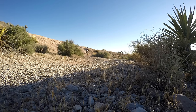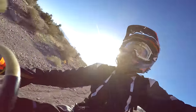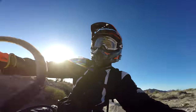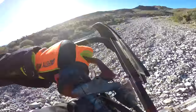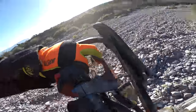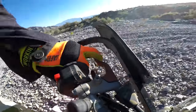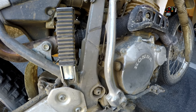Of course, the seat doesn't allow you to really sit up on the fuel tank to grab aggressive front-end traction like modern bikes do. But because of the geometry of the frame and suspension, which I'll discuss later, getting up on the tank is really just not all that necessary on this bike. The clutch pull is very easy when maintained properly and can be controlled all day with one finger. However, if the cable is never cleaned or the lifter linkage is never lubricated, it will eventually seize up and the cable will be at risk of snapping.